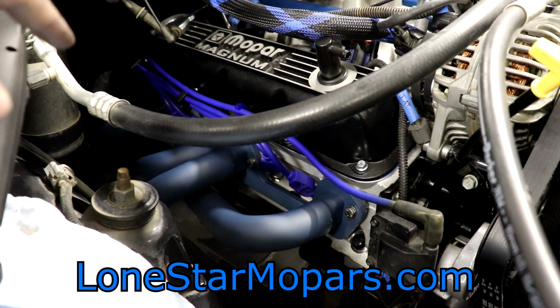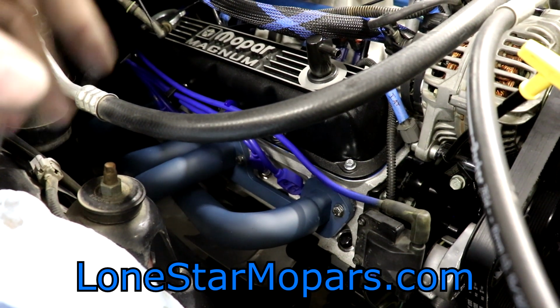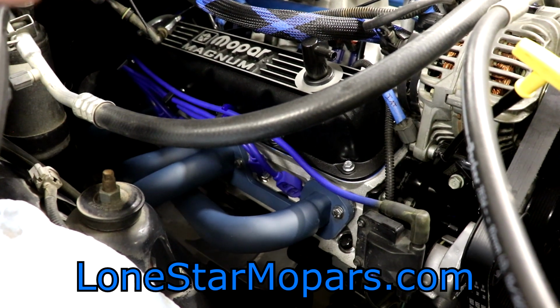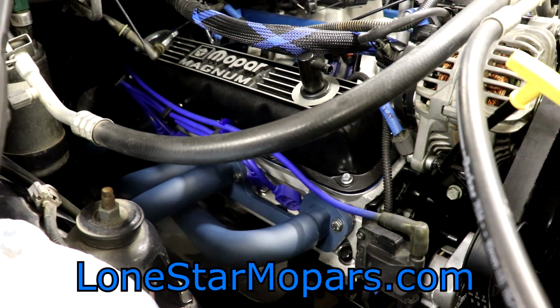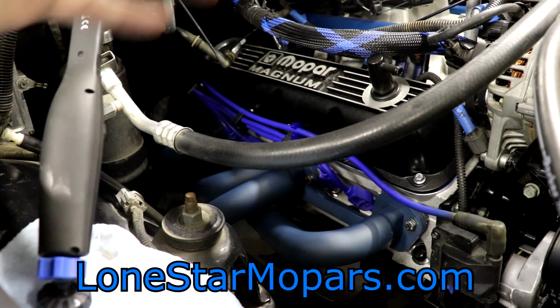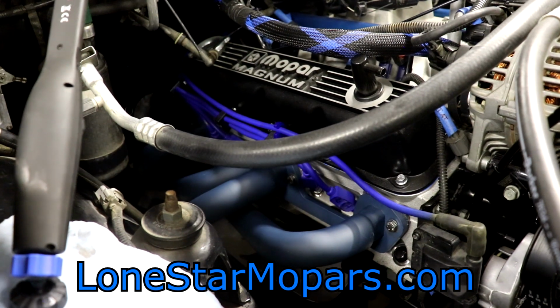Throw some towels or rags or duct tape or something over the crevices. It might waste time, but if they do fall, you'll save time. And I'll tell you, 80%, 90% of the bolts that fall out go straight to the ground. But we have one totally gone. I have no clue where it is. And we had one get stuck there. I had at least 2 more go down on each side, and I was able to just lift them out real easy with a magnet.